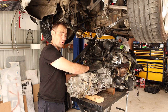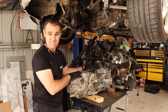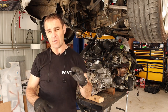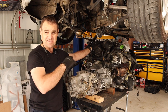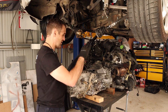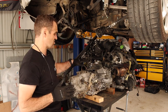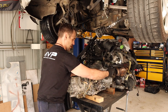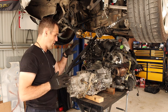I have now bolted the Rockstar transmission onto the Audi V8. For those who haven't watched previously, this is a direct bolt-on because this gearbox is essentially the same gearbox that Audi and Volkswagen have used in a lot of their front-wheel drive cars. I haven't got a flywheel and clutch yet. There are adapter flywheels — a lot of Audi guys have converted their cars to manual, so there are manual conversion flywheels with a different pickup for the crank angle sensor, since the factory crank angle sensor on the auto is in a different spot to the manual. I believe a lot of them use clutches out of an RS4. Some builds need a small spacer between the engine and gearbox to space it back a little bit, others don't. So I'm going without it to start with.